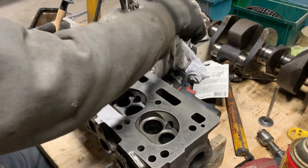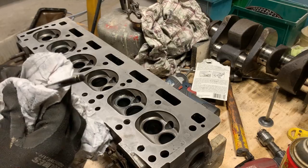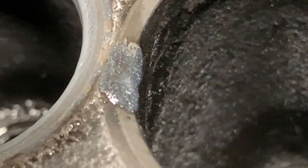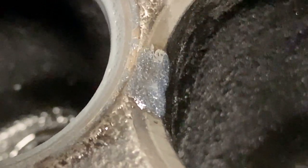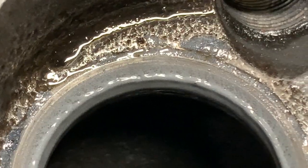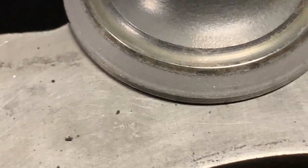Let's clean it and inspect it. Before I clean it I wanted to show you what it looks like — it turned milky, whereas in the beginning it was spread out like sandpaper. You can see what spread on the other side wasn't used and is still gritty. It's basically like liquid sandpaper and it works well in the beginning, but the more you use it the more it turns to milk, so you have to wipe it and put more fresh compound.